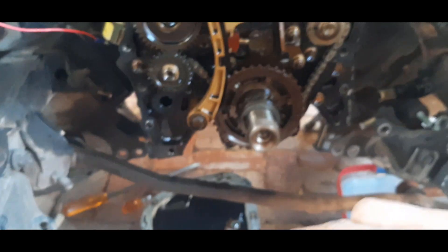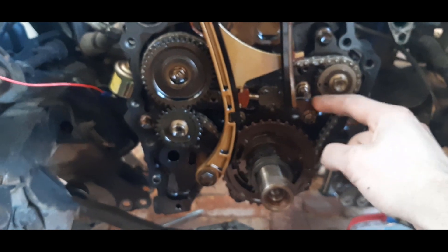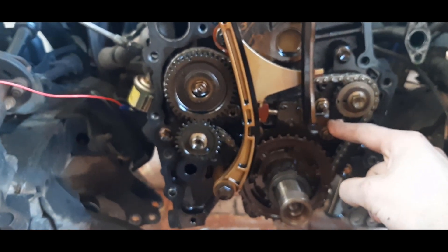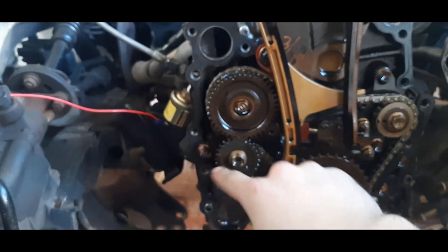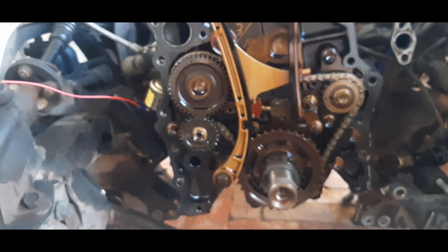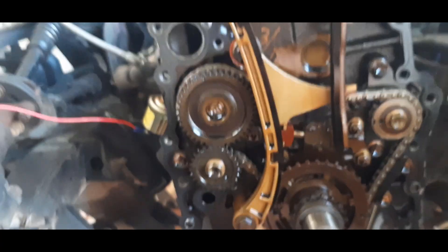What you need to do is pull off the chain guides. This part's going to be kept — that's the oil squirter for the bottom of the chain. You have to block off one of the oil ports on that one; I'm going to show you how to do that later. But apart from that, all of this chain, these gears and that, they can all just vanish because you don't need them. It's a good idea to watch the LC Engineering video — I'll link that in the description.